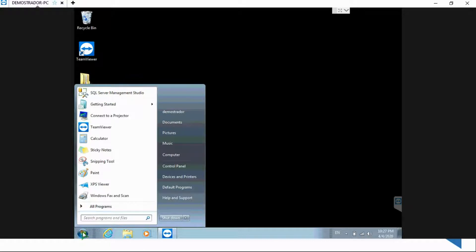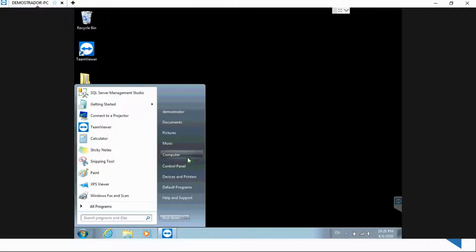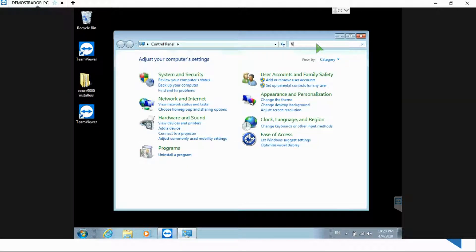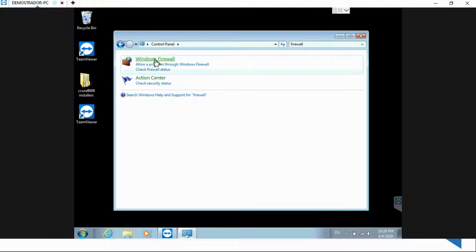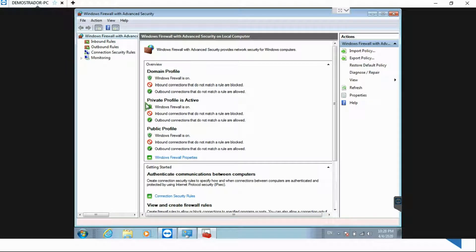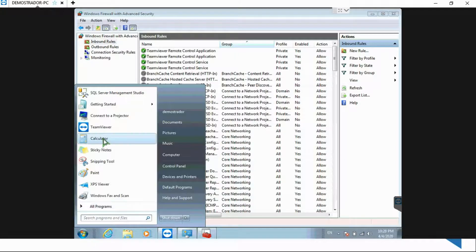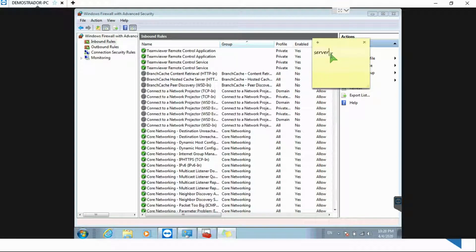What we need is to get to the Advanced Settings. There, we're going to add the ports needed — TCP ports, in inbound and outbound — which means we're telling Windows these are the ports we need for the Kantech system. This computer will be used to install the server, which will be the main computer with the database. In my case, I'm going to install all the components on that same machine: the server, the gateway, and the smart link.